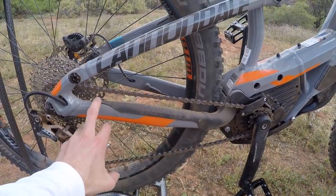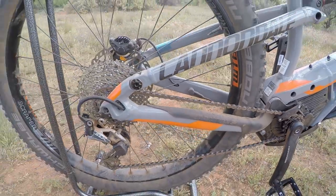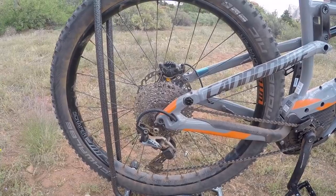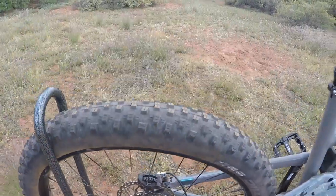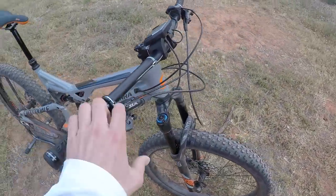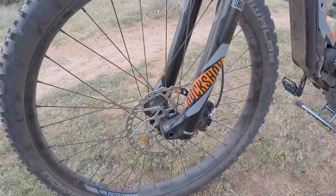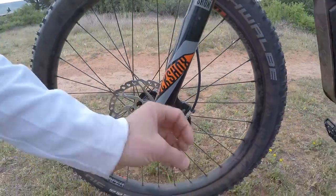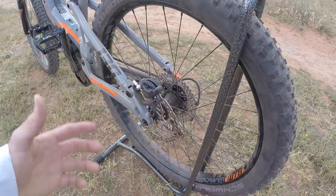Love that they've got this really integrated rubberized slap guard, and you can see there are a bunch of nicks here. We've been riding around all day. 11 sprockets in the rear, that's 11 to 42 teeth, so a great range to ride with. Just really well set up, good components, and that carries over to the brakes as well. So hydraulic SLX disc brakes, we've got the finger adjust on those levers, two finger, 180 millimeter rotors, the SLX calipers with Ice-Tech, and you can see the little, it's sort of like a heat sink there, reminds me of computer parts and stuff. I really like that, so it's gonna dissipate the heat a little bit better.